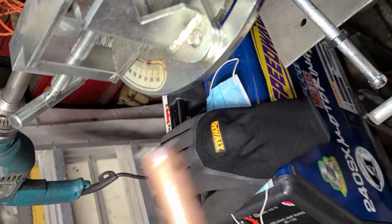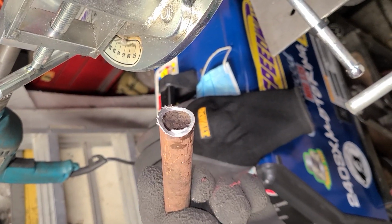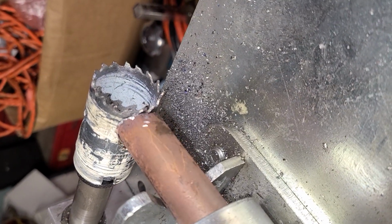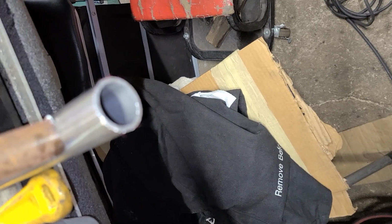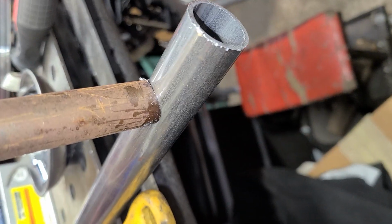So what I'm notching over here, which I just notched, is this good old tube, which is a 120 wall 3/4 inch tube from Home Depot that I just notched nicely. See, I love notching. Yes, this is the tool I'm going to be using for my roll cage. And since it's a 1-inch tube, it's going to sit perfectly on top of it. So, not going on that particular tube.